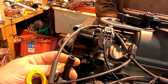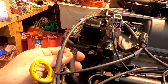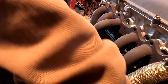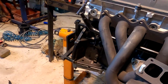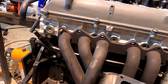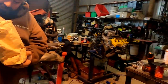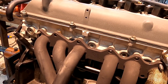Why is there still a water hose here? That was the one that goes to the standard throttle body, but there's no standard throttle body anymore - someone forgot to blank it off. He'll weld that up or reuse one he already has in the right size. There might be a boost leak. He can't find his nuts - there's a bell housing bolt in his bag. Six Boost exhaust manifold on it.